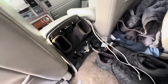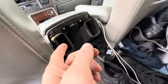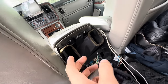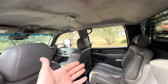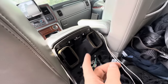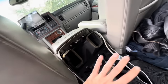I'm not entirely finished — I still have to custom fabricate the back of this center console. The reason is that Escalades never had a rear AC vent system coming out of the center console; that was for the Silverados only. All the Escalades had their vents up in the headliner, but I wasn't about to reroute AC function to the headliner. So it wasn't a direct swap — I've got to take pieces off my old console and fabricate them to fit on this console, and then I can put that panel back on.